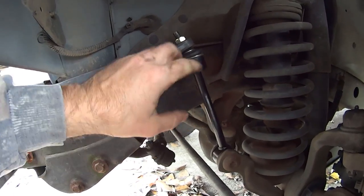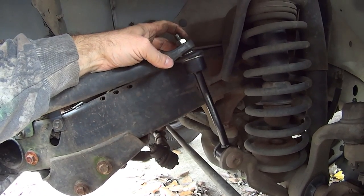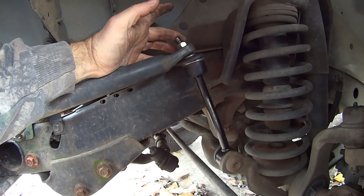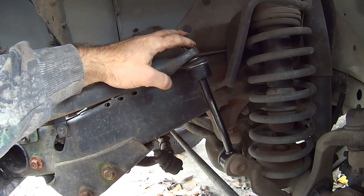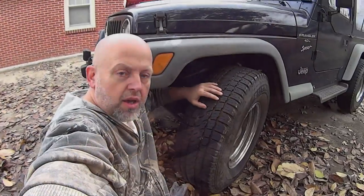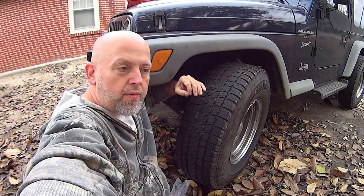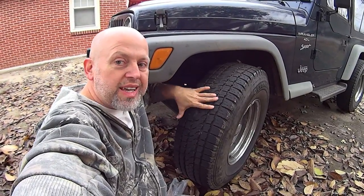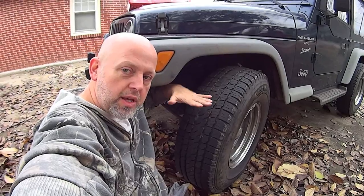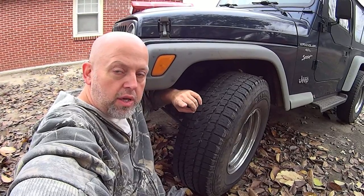Okay, we have them all reinstalled. One quick pointer: nothing is supposed to ever loosen back up once you tighten these, but give yourself about 50 to 100 miles and come back to check everything and make sure it's still tight. There you go — it's not very hard to change them out. Just in case your Jeep is going down the road with a bad sway: a lot of four-wheel drive enthusiasts disconnect those end links when rock crawling, and that's fine, but going down the highway it's not so fun — it has a tendency to shimmy and float and do all kinds of unsafe things. So change those end links.